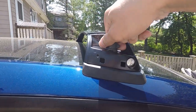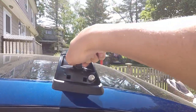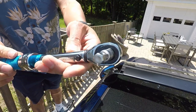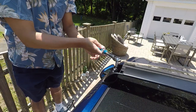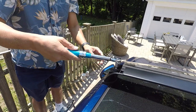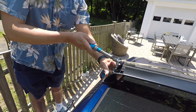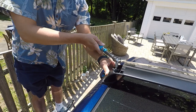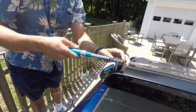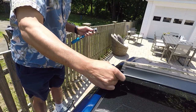To test, pull them in all directions and ensure that there's no movement. There is a mark on the wing nut that must align with the mark on the tower in order to lock it, so note that mark as well. I got a torque wrench from Amazon to try to apply the exact force, but it did not work well for me. The tool is supposed to click when the target force is reached, however the force was so light that the ratchet would not click, and I was afraid I would over-tighten the bolts. So I ended up just hand tightening them, and that's what I would recommend.